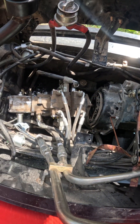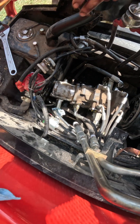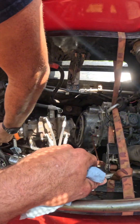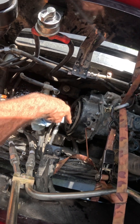We got that out. Obviously this line's off — so that's where we're at right now. Got a strap here, shackle there to hold the engine up, because we're gonna have to release the motor mounts down here — that's next.